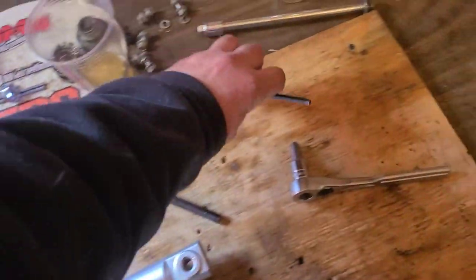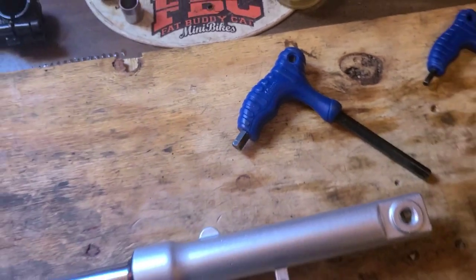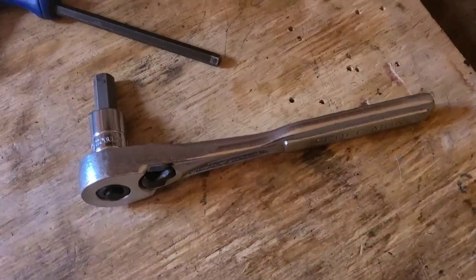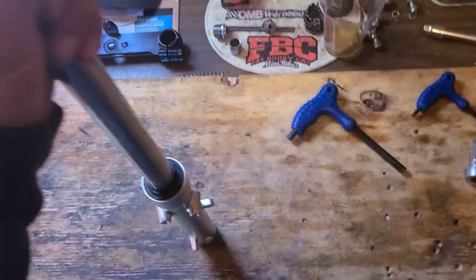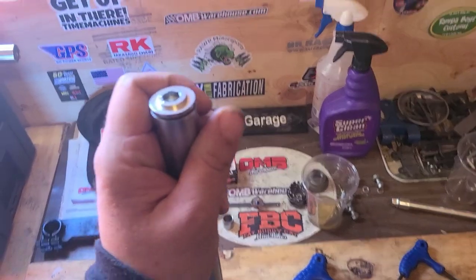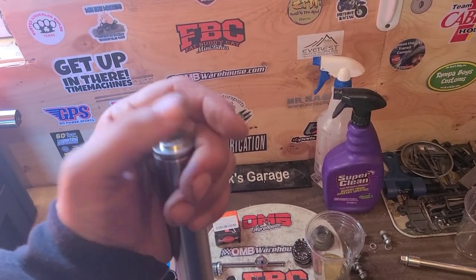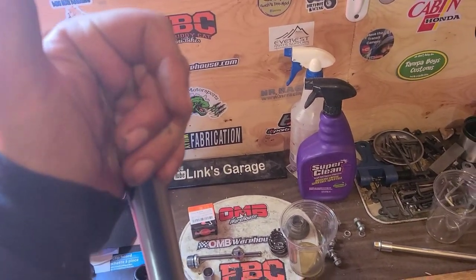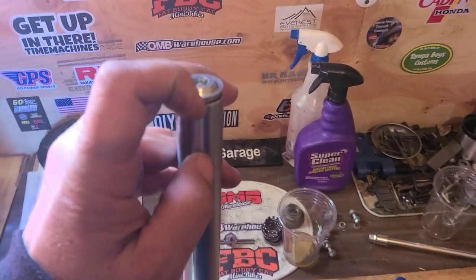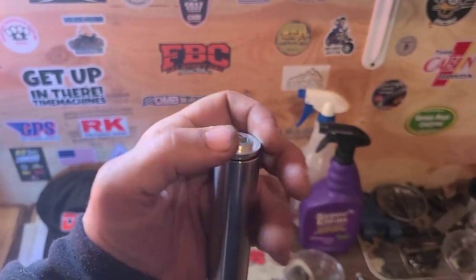Put the clamp aside. I have my next wrench. It's that 10 millimeter. It's a lot easier to handle one of those than one of these on the ratchet at this point. I'm going to use that one to continue to back my cap bolt out of here. And then when it gets loose enough, I'll put the wrench down and I'll use my thumb like this and I'll cup the whole thing with my hand. That way, once this comes out, I can catch that, and then I have those other two bullets behind it that are sitting on top of that spring. So that's the move.